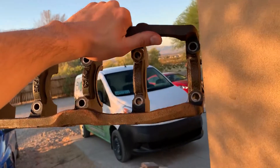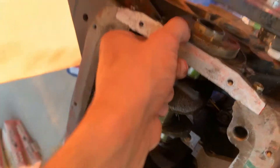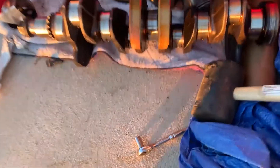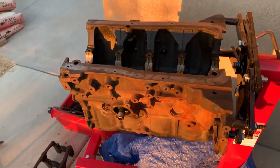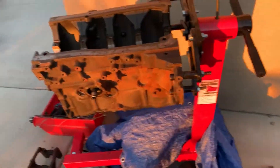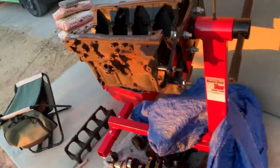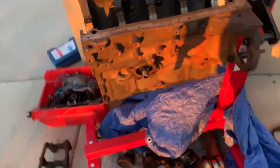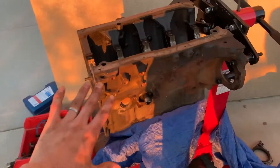This is one of the hardest things to take off. To remove the crankshaft, there are two bolts right here — take this piece off, though I'm not sure I can get to both bolts. That was a heavy son of a gun, and just like that we're down to bare block. My goal is to sandblast it and then get a prep kit and clean it. I'd sandblast it today but the sun's already almost down, so I'll make a separate video sandblasting this really soon.